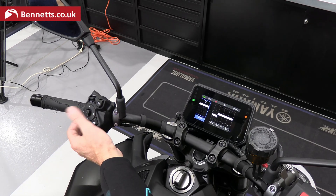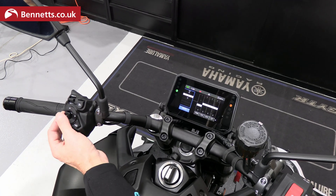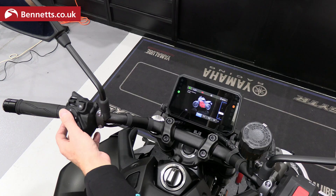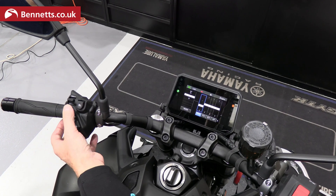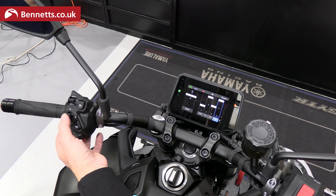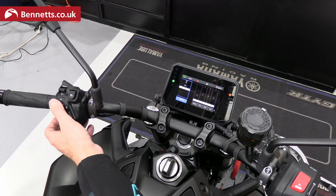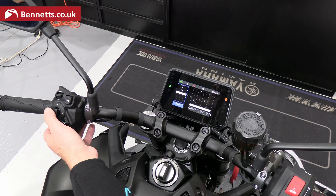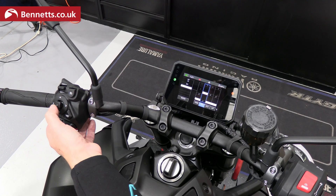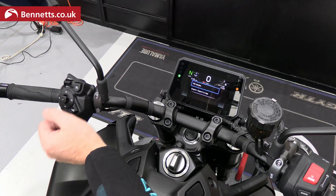Because this bike has automatic, you can also preset what the automatic systems are going to be. Here we have the D+ system — that's the aggressive one. You might decide you want a more aggressive throttle, so you can select into there and set it on minimum traction, slide controls, and minimum lift. That becomes a fixed setting for your D+. Going all the way back across, D is effectively more like a rain mode, so maybe a little more traction and a little more lift — liven it up a bit. And there is your automatic mode set.